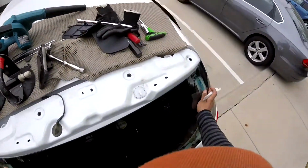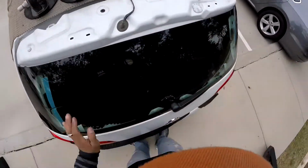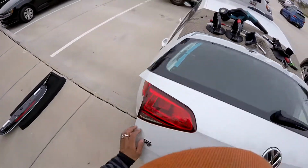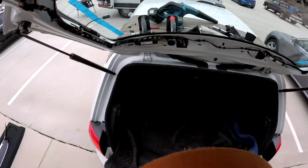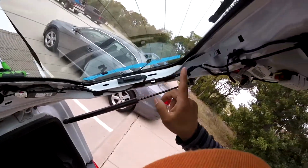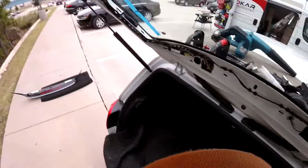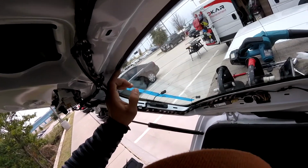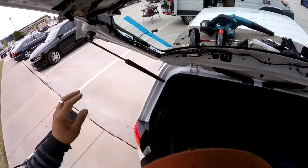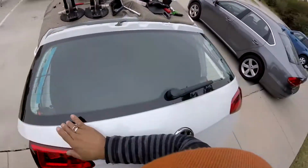Okay, it's the same one. Okay guys, so we finished setting the glass. Now I can just do this because I put this one on, so it's not going to make any problem. You see the bead is inside, no problems, not too much outside. Remember, if you put too much glue, it's going to be outside and it's going to mess the panel. So it's nice. It's a little bit sharp, but that's no big deal. That's the limit. If you pass it here, you're going to have the sharp edge inside the panel. At the top is the same, and outside we don't have any squeeze. Okay, that's important on this kind of exposed edge.